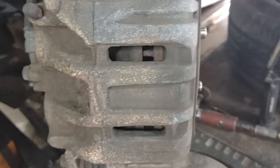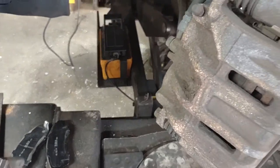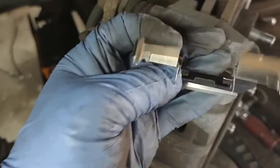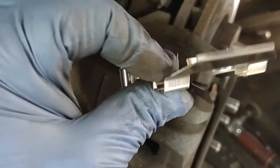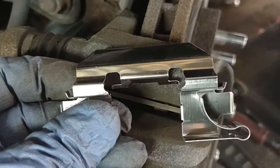This car has very low brake pad thickness — I'm going to show it to you once I take it off. Also make sure you change the brake hardware kit. Those things the brake slides on — I recommend changing them. I've seen a lot of cases where they never change them, even with big name stores. I've seen cars come in with the old hardware still on. You can see this is the old one right here — you better put the new one on.